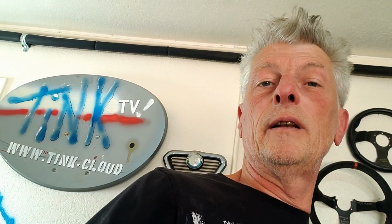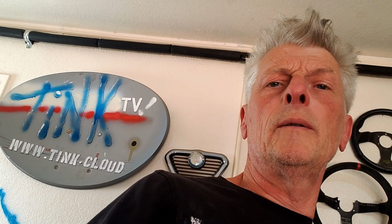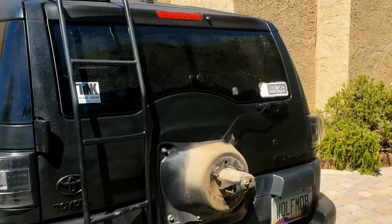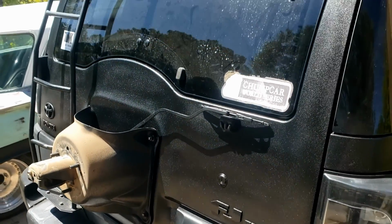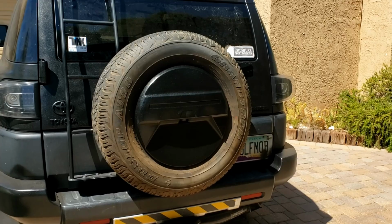And yes, in addition to employing my normal technique of stop-start at the end of each spray, I held the can a little bit further away because it's gloopy stuff. So don't be afraid to mist it on from somewhat of a distance compared to the normal 4 to 6 inches. I was kind of 6 to 12. And there's the final panel done, the back, which actually I got better at as I went along. So that's pretty damn good. Lovely. Would have been rude not to do the wheel cover at the same time. Job done.